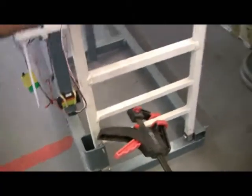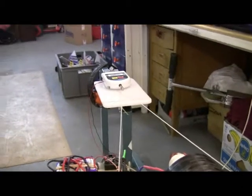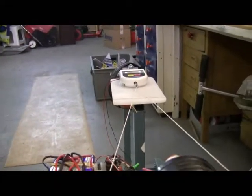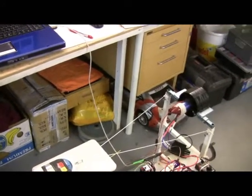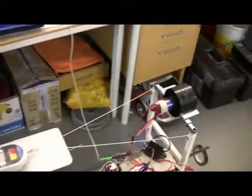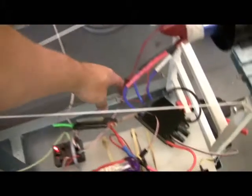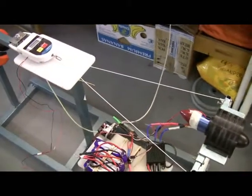This one is moving if it's possible to see, so then it pulls in — it's pulling these cables to the digital scale. And then I have all other parameters hooked up. We have a pitot tube over here which tells the air stream speed when it comes behind there. It's maybe not 100% accurate readings, but it's a good comparison between if you have the same setup — you can at least see the differences. Then you have an engine temperature on the outside here; it's of course much warmer inside. Then you have even these small cables for the RPM measurement. Maybe now you understand a little bit more about my nice little tool.